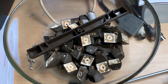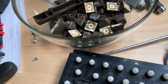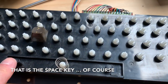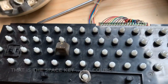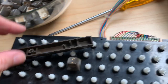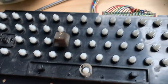It makes working this kind of keyboard a treat, because you don't have to fiddle with all the springs. There's actually only one spring, and it's only on the shift key. The shift key does have these stabilizers built in — you can't remove them. On most C64s the stabilizers are put as little stamps inside the key and you can pull them out and clean them. But here on this keyboard, these stamps are actually part of the whole keyboard's construction.